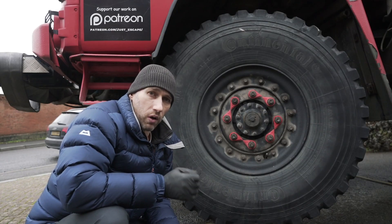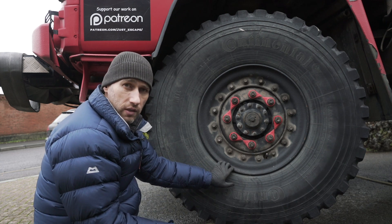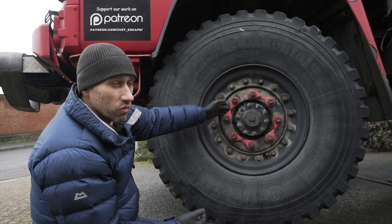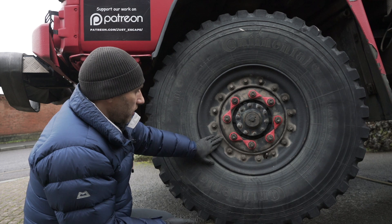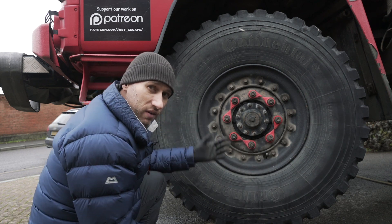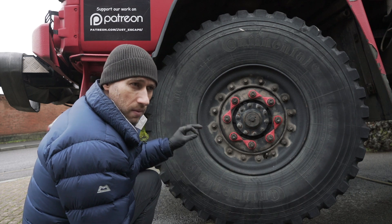In the morning when I start the truck, the brake system runs off air, and quite often that air will have depleted a little overnight, so you need to run the truck before you can drive it. Use that time to do a walk-around and inspect your wheel nuts. If you've got these indicator arrows, it's just a glance — I look at each and every one. I've got additional nuts on these split rims too, and I visually check those as well, making sure they're all there and haven't broken off, because that has happened.